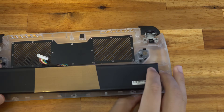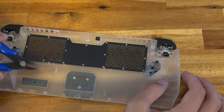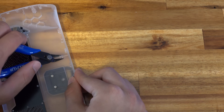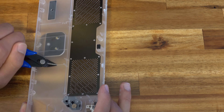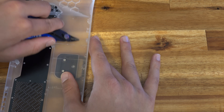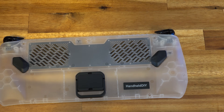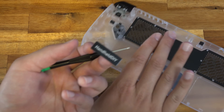Your back plate should now be fully assembled and look something like this. I also like that this back plate comes with a little kickstand on the back. Now I'm just dry fitting the battery on the back plate side — with this specific plate, there are a few areas you'll need to trim out for it to fit. So take your clippers and start working slowly to cut those pieces off. I also removed the little ridges attached to those squares to ensure the battery would sit fully flush. After cutting, feel with your fingers to make sure the edges are smooth. I also popped out the little badge that said 'handheld DIY' — just take a screwdriver and pop it out from the backside as it's held on with adhesive.